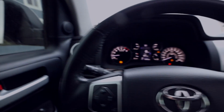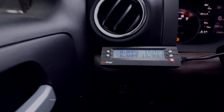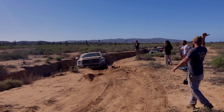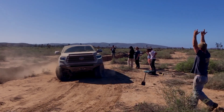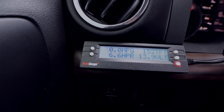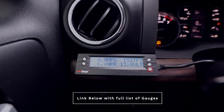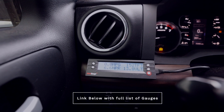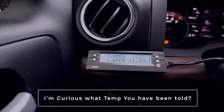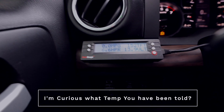Tons of people love to talk about Tundras and the fact that they don't have a cooler on their transmission and think they're going to blow up. The reality is I've actually never had a problem with that. People do overheat their transmissions a lot when they're four-wheeling in sand and soft soil, but that's mostly because they don't switch it to manual mode and leave it in automatic. When I am off-roading in those situations, I keep an eye on the temperature. When I see transmission fluid getting over the 220-degree mark, I know that significant damage is being done to that transmission fluid and I will need to be changing my fluid.